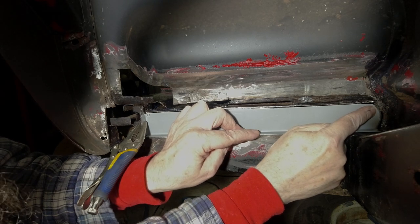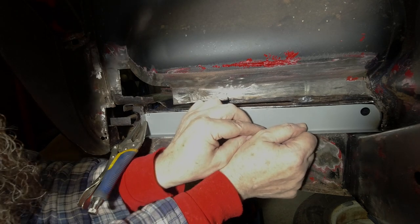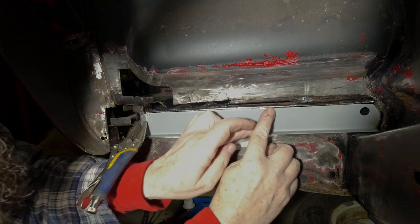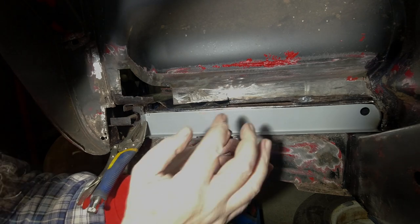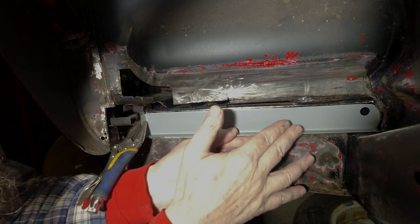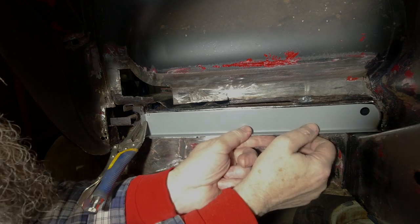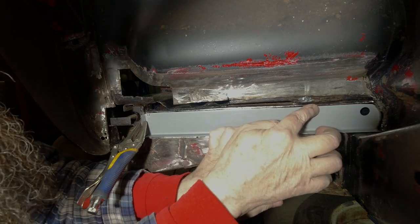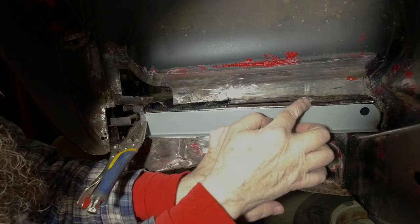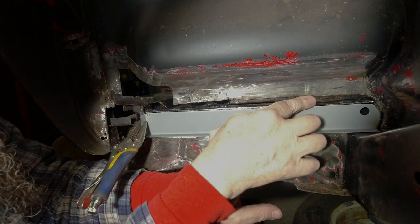Like I said at the beginning, there are three of us in here under this wheel arch — me, the camera, and Buster, and he's all over me. I've got to put Galva-Froid inside all around at the back before I go any further. I may even leave that till the next video. I'm thinking of cutting these videos down to 15 or 20 minutes instead of 40. There was a weld that came through on the other side in the previous video — I just took that down a bit. You can always dress welds up from the other side.